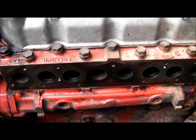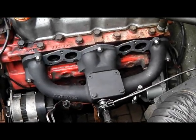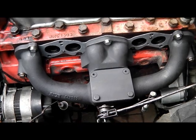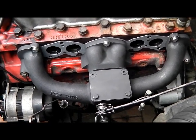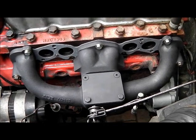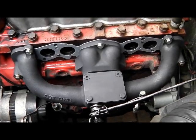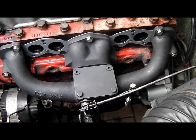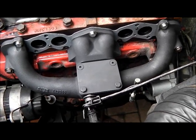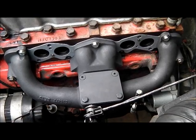The instruction book with the kit suggests fitting the inlet manifold first, but I've actually installed the exhaust manifold first. The reason is that having looked at it, I couldn't see how I was going to fit the exhaust manifold once the intake is fitted. So I decided to ignore that bit of the instructions — I can see why it says that, to do with clearance between the manifolds, but with the engine in the vehicle you can't really do it that way round.